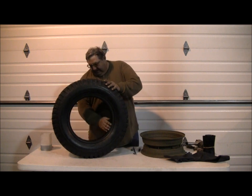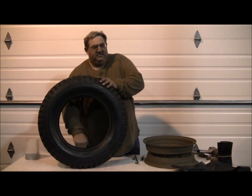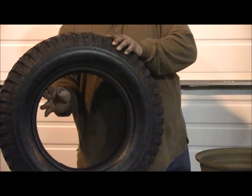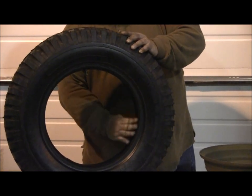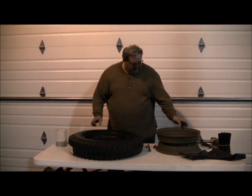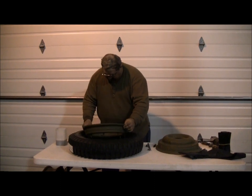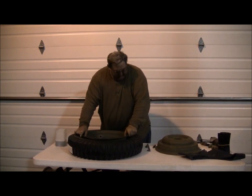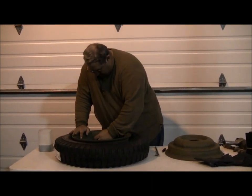At this point we've gone ahead and inserted our flap. You've got to take a lot of care in putting the flap in. You always want to run your fingers down along here when you're done. Make sure you don't have any wrinkles in it. Make sure the flap's not curled up on the edges of the tire. Any kind of a fold in the flap or the tube is going to give you a flat someday. So take some time and get that centered in there right. Once we have that properly installed, we start with our valve stem wheel half, lining up the valve stem and dropping the wheel in. Then we'll insert our tire tube guard, valve stem guard.